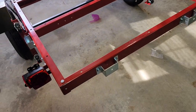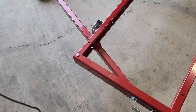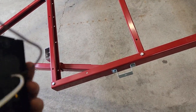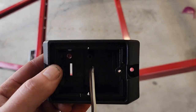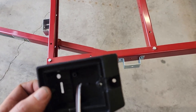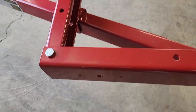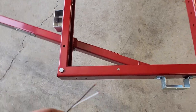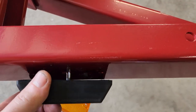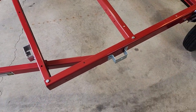I'm putting the lights on, mounting them all up now. I wanted to make a quick note and give you guys a piece of advice on these little side marker lights - they go up here on the front. You pop the lens covers off, and I'm glad I did because they had the wires running through that little hole right here. With the wires running there they're getting ultra pinched trying to mount this thing. I feel like that at some point would cause a short for sure. So I just drilled a little hole right in the center and now it matches up with the hole - you just shove the wire through there like that and boom, there's no undue stress. Give that a try.